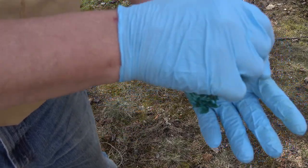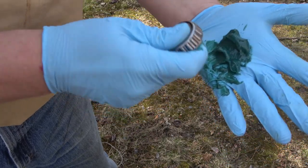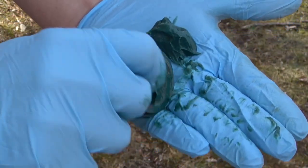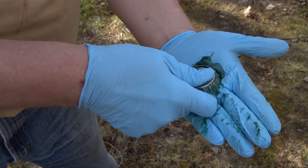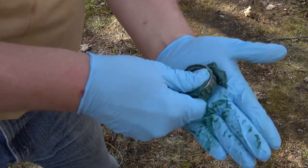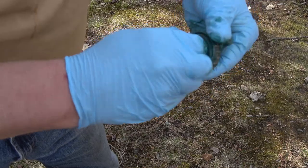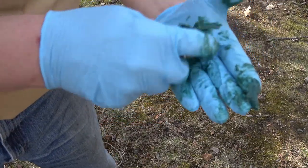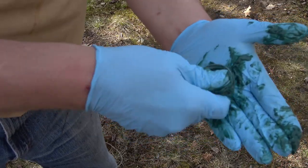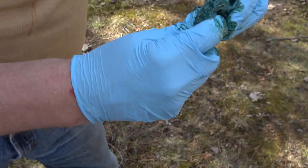What we want to do is push that grease inside those rollers using a scooping motion. You put a dollop in the palm of your hand, grab the bearing, and push it through the grease — that forces it up into the bearing itself. It's a messy job, but you're forcing the grease up and through the rollers. Keep going around until it's forced up into the bearings, and every once in a while give it a little spin to coat the bearings. Eventually you'll be packing the inside of the bearings and races with a nice good gob of grease — it's coming through the races, it's packed all inside.